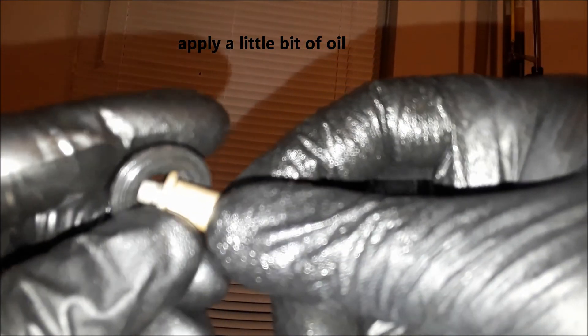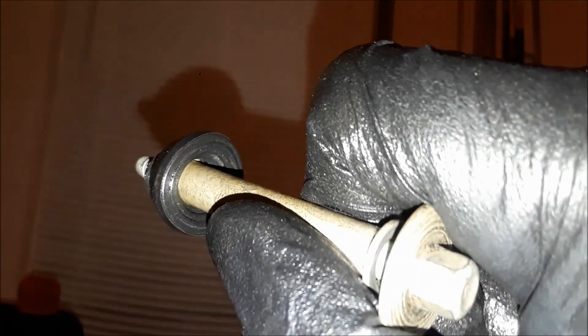When you're changing your grommets and valve cover gaskets on a 5.3, 5.7, 6.0, 6.2 — whatever — and you're trying to get this sailboat grommet on, what you're doing is coming in at an angle and pushing on it. No heat. See, it's already halfway in there — you keep turning. When you get to a certain point, you're going to squeeze it and you can collapse it in there just like that. It's all about manipulating the rubber. Then you have this other little hump — go at an angle on this side, you can see it being revealed, then go on the other side and pop it in just like that. No heat.